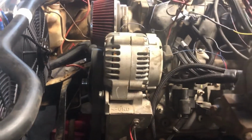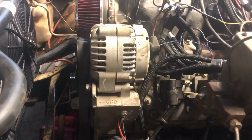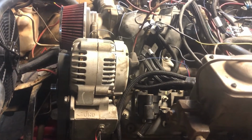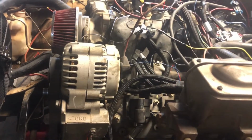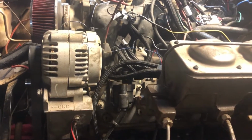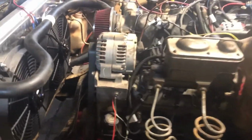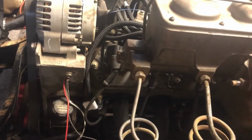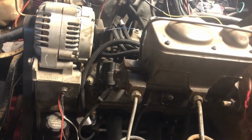Especially when I get my AC on there, I'm going to have to, I think, because of the way the belt's going to fit. But anyway, the thing starts, it moves under its own power. I've got to adjust the clutch just a little bit. I got it too tight and it's riding the throw out bearing all the time. Let me see what I did yesterday. Put the drive shaft in, got most of the computer work done. I'm not getting my 7-inch screen to update, so it's not really acknowledging the computer. I mean, I'm getting some stuff.